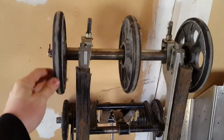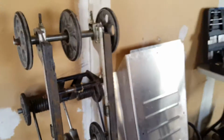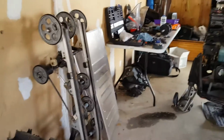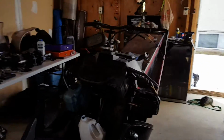But here's our old skid. Most of the wheels are in good shape. Sliders were obviously never a professional install. It's got some bent suspension parts. As you can see, it's been ridden on the rocks a whole bunch. That's common with these fan-cooled models. They kind of turn into farm sleds after a while. They're really ridden in places that don't have a whole lot of snow, and that's why they're fan-cooled. So the skid really takes most of the beating.